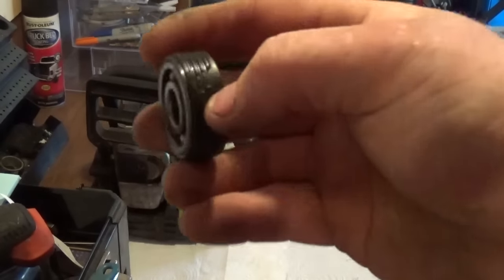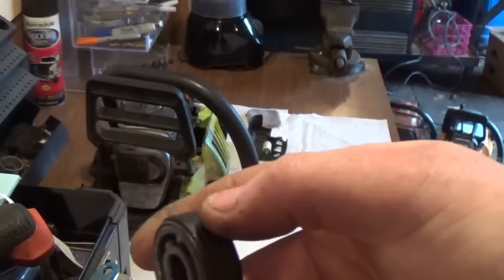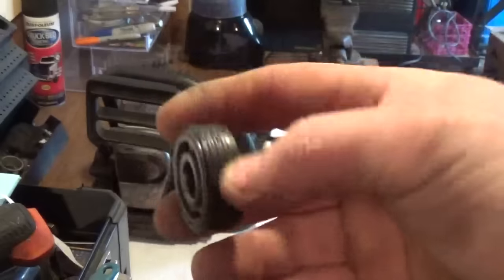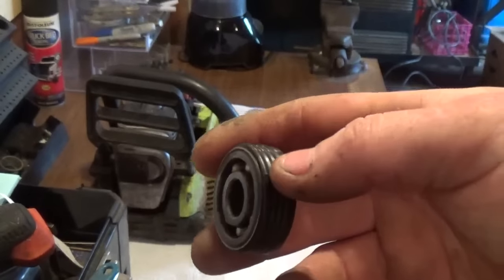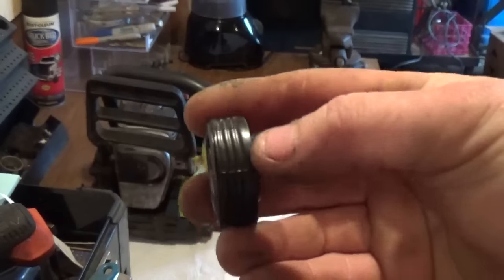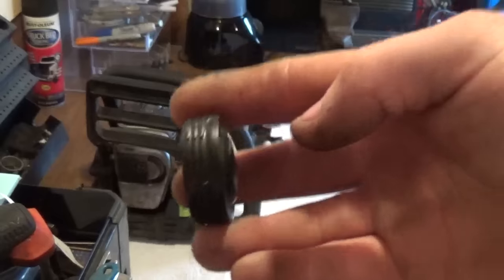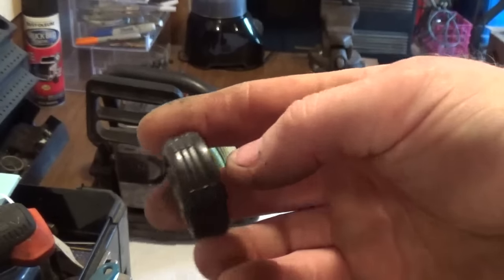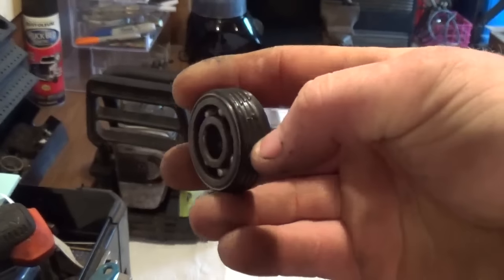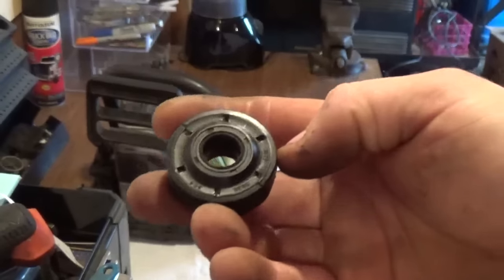So as you can see, that seal can leak air. Now if the seal can leak air, that's going to make your saw run erratically as hell. You may be lucky enough to get the saw running, but it just won't idle. Or you may actually get it to run and it'll take off with itself. The bar and the chain will just coast like crazy and you don't even have to give it gas. The saw will just behave really erratically.